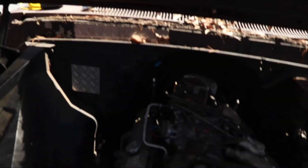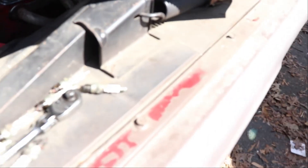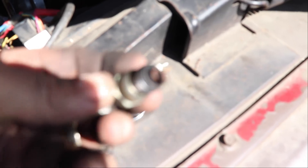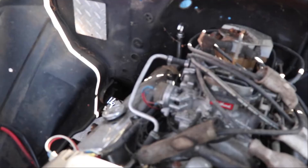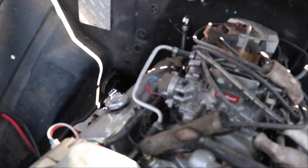I took my little camera probe and looked in cylinder number eight — spark plug one, two, three, four, five, six was this one right here — and it was pretty wet and soaked. It wasn't oil; it was too thin to be oil, it looked like muddy water. I was a little concerned, so I stuck my camera probe down in there. No standing water inside, a little bit of flash rusting on the cylinder wall, but all in all it looked decent.